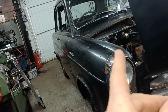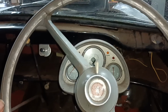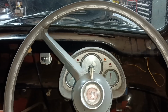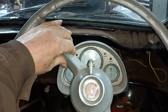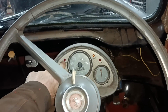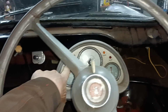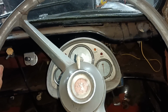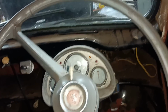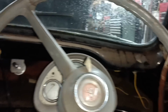So, the question then is, is the steering wheel straight when it's in that position? Let's do that. When I drive down the road, as I look with my dominant eye, which is my right eye, this spoke of the steering wheel was like that beam light, there was just one side of it, and that oil light, there was just the other side. So as I'm sitting here now, that is the straight ahead position. Okay, so that's when the wheels are straight.